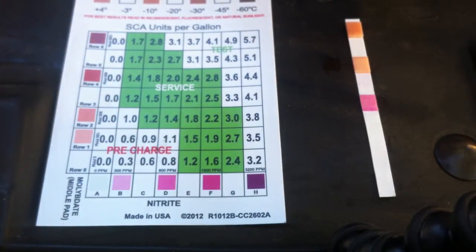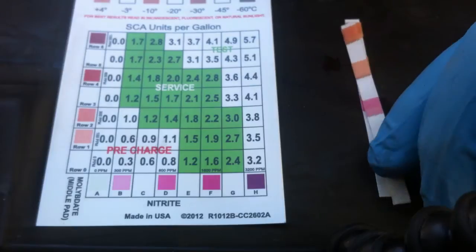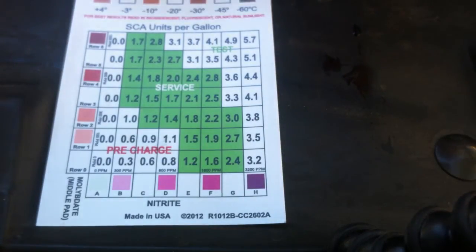So that's how you measure your Ford Gold Coolant. It's pretty easy. A lot of people like to switch to the red coolant because you don't have to do this — do your research and decide if that's what you want to do. But if you do have Ford Gold Coolant, it is important that you maintain the SCA additive, and this is how you test it. It should be done every couple months — that's at least when I do mine. It's pretty easy, but you do need to stay on top of it.